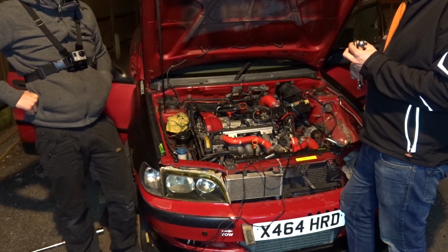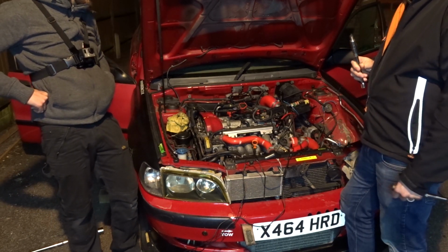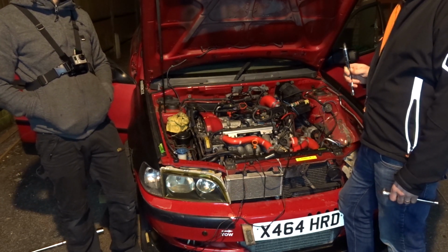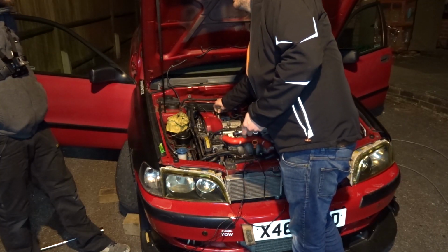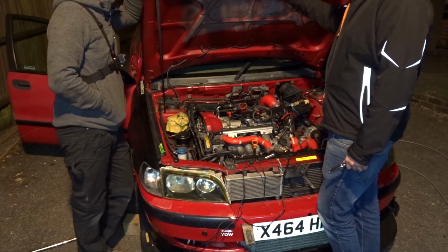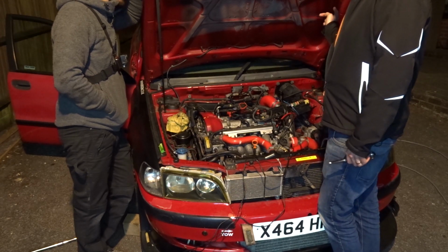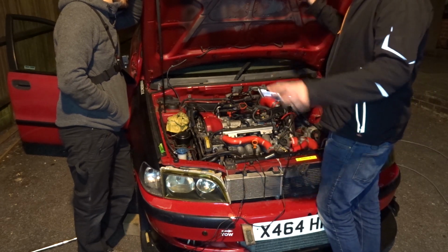Yeah. There's no way we could be 180 degrees out somewhere, is there? Well, that's what I was thinking. I don't think the light can also flash at alternate positions. If it's wasted spark, the light will flash at 0 and 180. That's why the light flashes so quickly, because it's doing wasted spark, isn't it? You've offset 90 degrees one way, it might be the offset is minus 90 degrees the other way, which would explain why it's sparking and fueling and blowing out the exhaust.